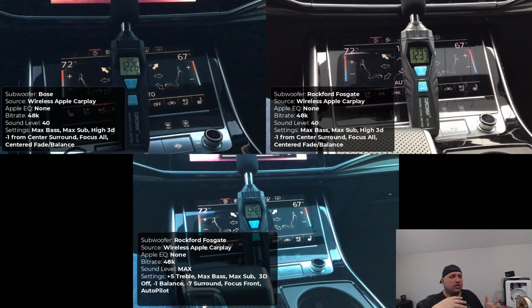So I'm going to quickly explain what you're seeing here. You'll see that in this particular picture, and I didn't cherry pick this, I just did a random stopping point inside of this video, the Bose system and the Rockford Fosgate system are pretty close to each other in sound level. They're within 1 decibel, which can be louder, but it's not anything that you're going to be like, wow, this is massively louder for the sound pressure inside the vehicle. You'll also notice that the graphic down below, from the Bose system to the Rockford Fosgate system with the different tuning inside of the Bose system settings itself, is actually 2.2 decibels louder.